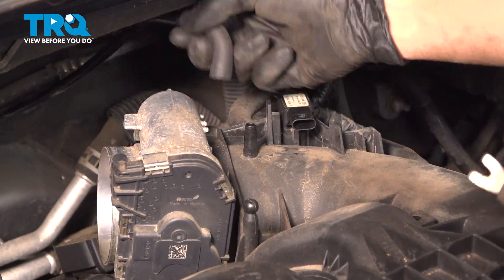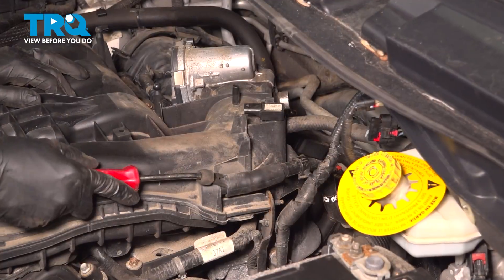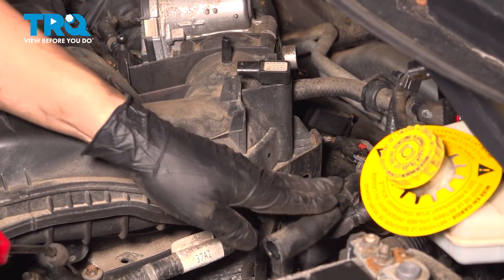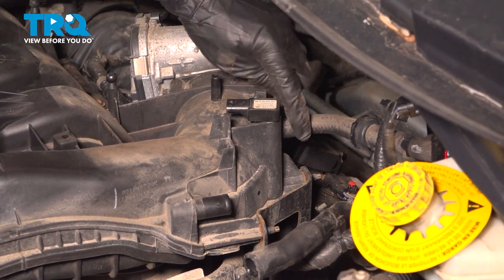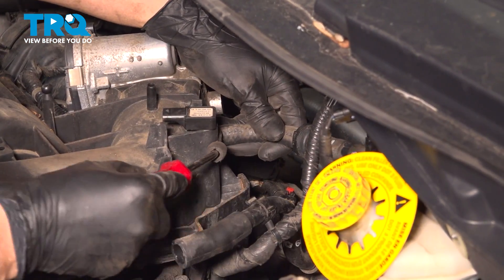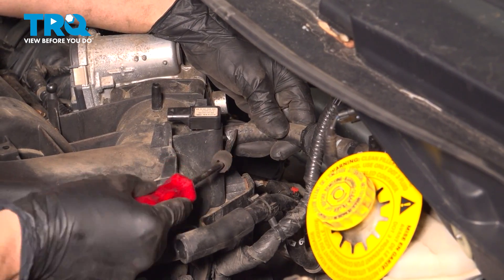To get the air box off, it's just sitting on some rubber grommets, so pull really hard upwards and it'll pop out. Then slide it out of place. Once it's off the back and off the throttle body, pull backwards to un-latch it off the front. Let's take this hose off and set that aside. Pull this hose off the intake — this is for the rear valve cover PCV valve. And there's another vacuum hose right here. Be gentle if you have to use anything to pry these off — you don't want to break anything.